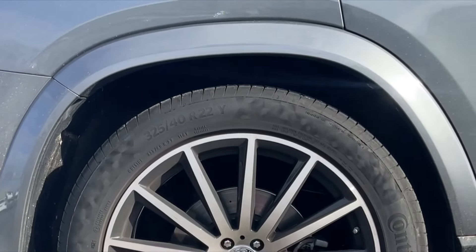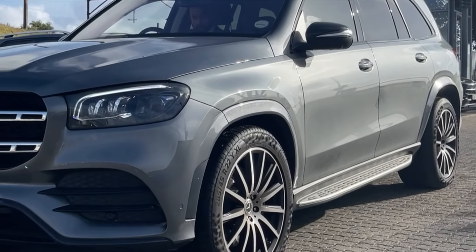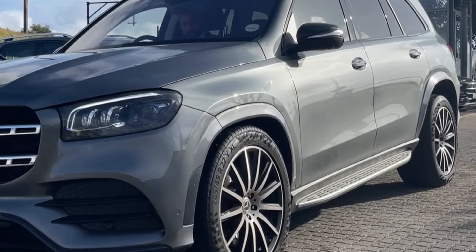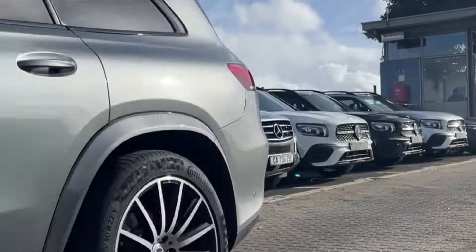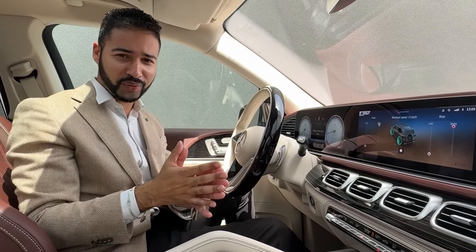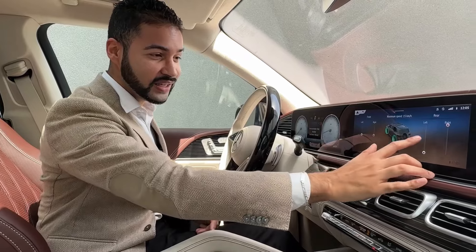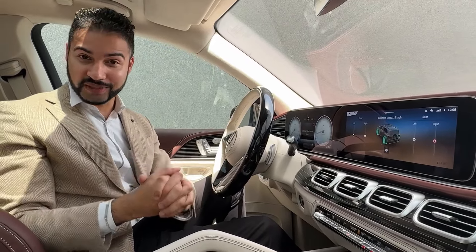I can tell the car to lift only the left-hand side — so this is basically the car leaning. If we are turning to the right, she will drop the right-hand side and lift the left-hand side. If we are turning the other way, she will do the opposite. The suspension system is incredibly powerful — this is the innovative e-Active Body Control suspension system from Mercedes-Benz.